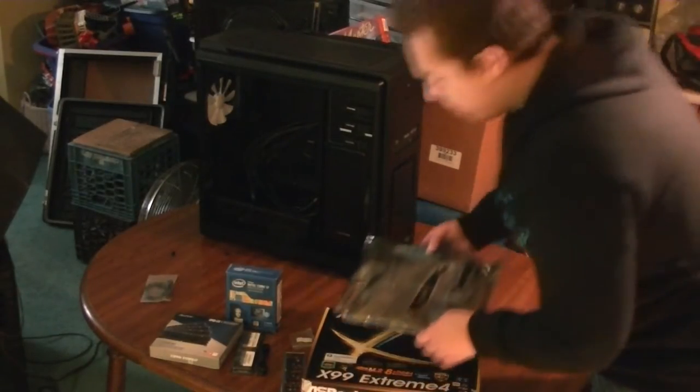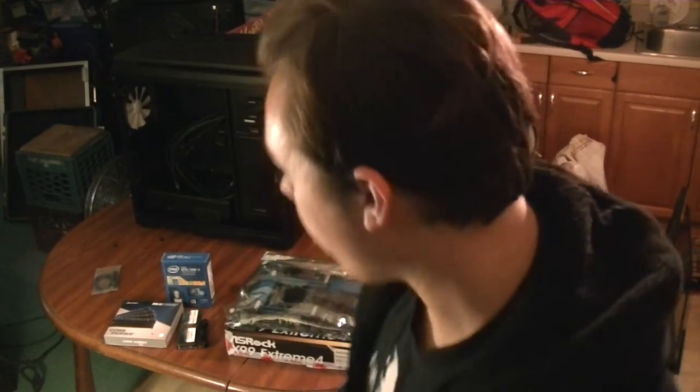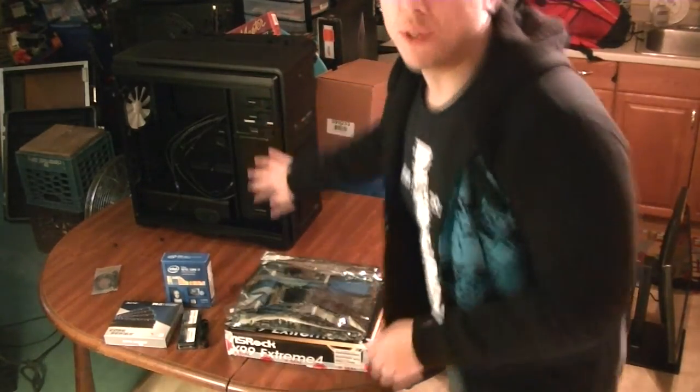For the sake of it, I will be putting it together on the actual box outside. Before we even touch the motherboard, we're going to make sure to ground ourselves on our case, and obviously do not work on carpet — this is linoleum. I'm going to be periodically touching that in a paranoid fashion just to make sure that I don't static shock any of my parts.